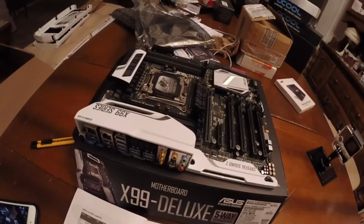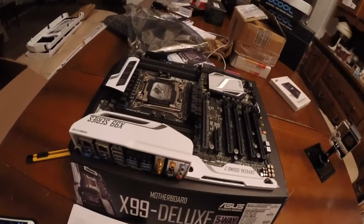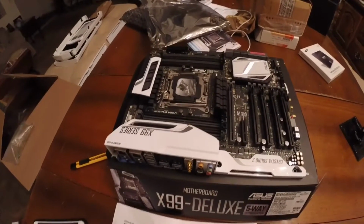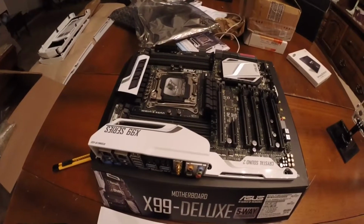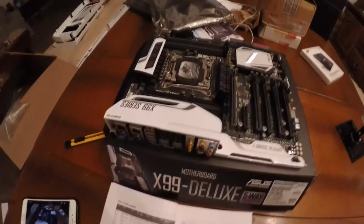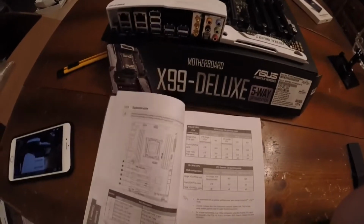So, there's a note in here that Asus exclusively provides HyperDIMM support function, subject to the physical characteristics of each individual CPU. Load XMP and DOCP settings in BIOS for HyperDIMM support. And then again, it tells you to look at the QVL. I already know that my RAM is compatible.